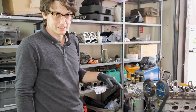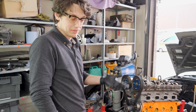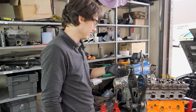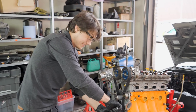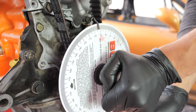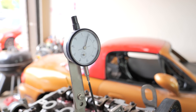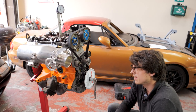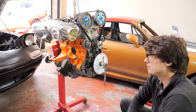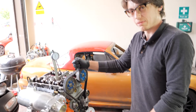We just had a false start with the tool binding, but we've made an adjustment. Now we should be able to find where the cam — or really the bucket — stops going down and starts coming back up again. We are literally at — the dwell makes it 95 and we wanted 110. So we're slightly off.